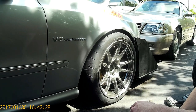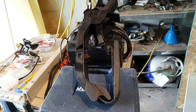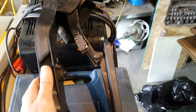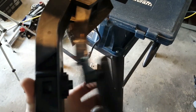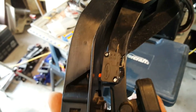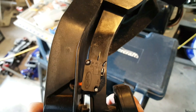The other thing I've done is on the accelerator pedal for the E55 — I've put a switch right there. When you press the accelerator all the way down, there's a kickdown detent at the bottom, and pressing that will also activate the switch, which will control the rear wing.